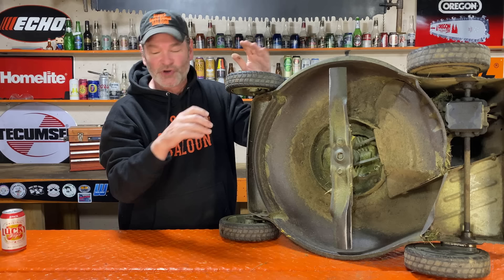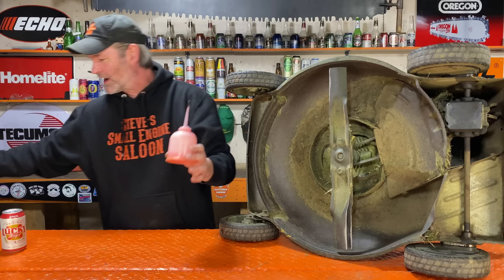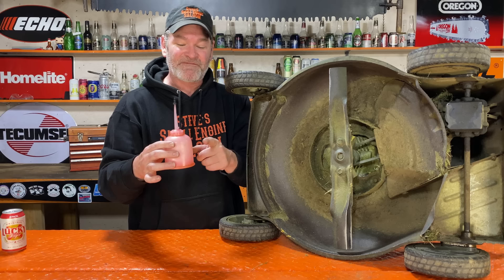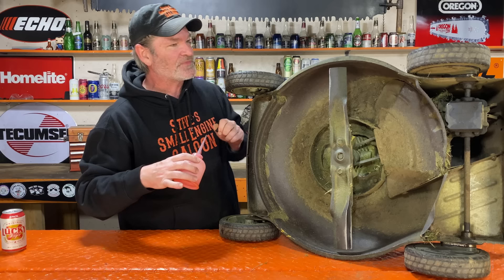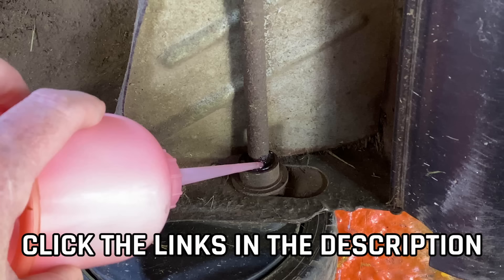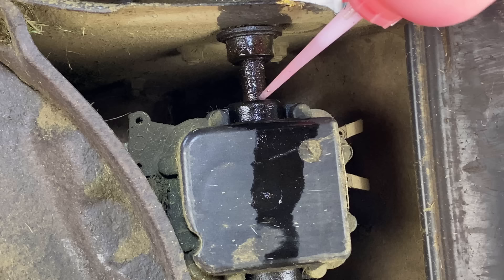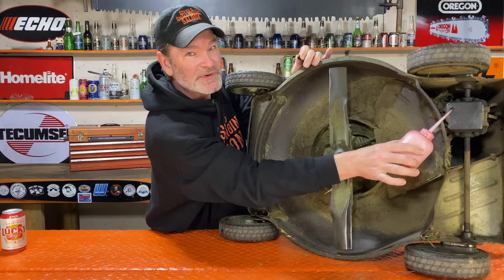So do this — a little bit of penetrating fluid, spray lube. You can use spray lube, but I always go to my concoction: ATF, 50% automatic transmission fluid, 50% acetone. Always works for me. I have a video on that in the description and pinned comment. You just squirt a little bit in there so it soaks down into that bushing. I also throw a little bit on top of the transmission gearbox — I don't think that's the problem, but it's just general maintenance anyway. Put a little bit on there, it's not going to hurt.